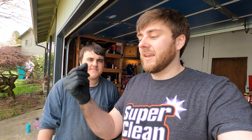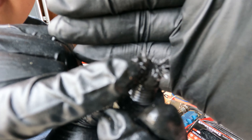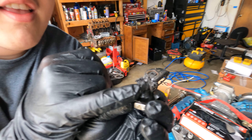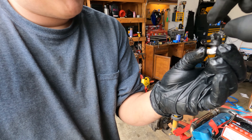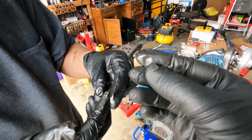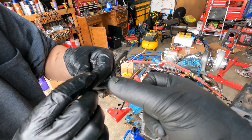We're a little bit into this — the GoPro died so you missed some of it. We pulled the drain plug on the transmission and for the first second it was just straight gray color, like silver, and then it went to dark red. And when I took the drain plug off, it's got this big chunk right here, and then another chunk. Your drain plug is not supposed to look like that. Something broke — we might find out what. The transmission shop is going to find that out and they'll probably have a new invoice.